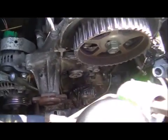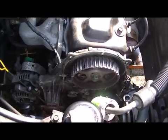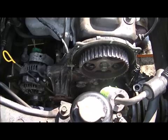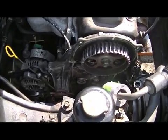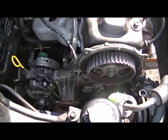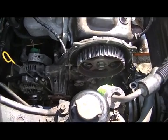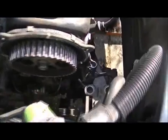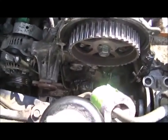This car has been maintained by fools. Every car mechanic who's worth a name knows that when you are about to replace a camshaft belt, which obviously has been replaced, you should also replace the tensioner, and usually replace the water pump as well. Well, they did not. They only replaced the belt and did nothing else. So now I'm about to do the whole procedure. So it's not only the tensioner pulley, but also the water pump that's going to be replaced, the tensioner, and of course now that I'm there, I replace the belt as well,